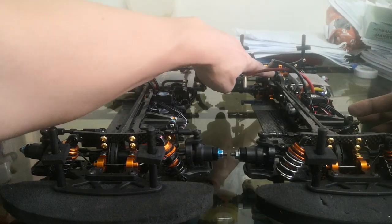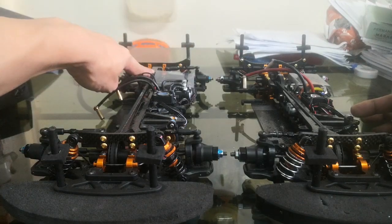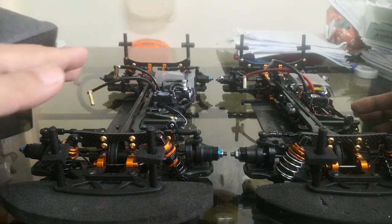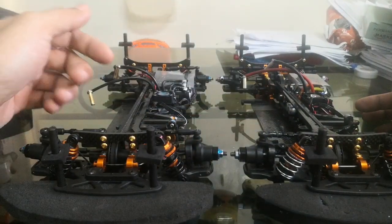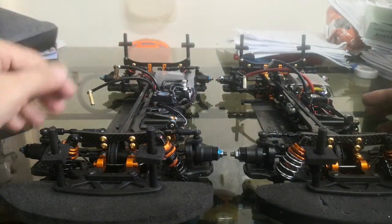The blinky car uses a spool. The rear diff on the open class is 3k oil, and this one is slightly heavier at 5k, so that on power exit it will steer more and we can put more power down without it understeering too much.